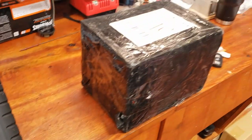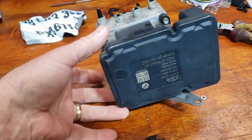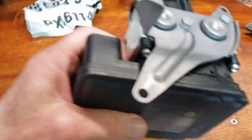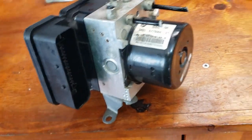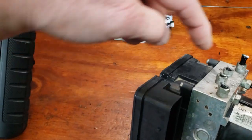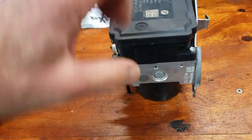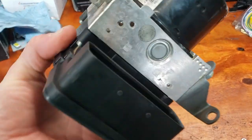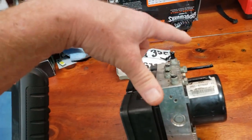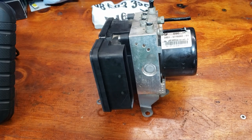We're going to unbox the valve, put it in the car, connect it to the harness, and see if I can program it. This module came out of a 2008 335i — it's got the same part number as the module in my car. The reason I'm going to try to program this module first instead of swapping electronics is there are about 10 to 12 seals you're supposed to replace between the module and the ABS pump motor whenever you separate them. So instead of disturbing those seals, I'll plug this in and see if I can program it.